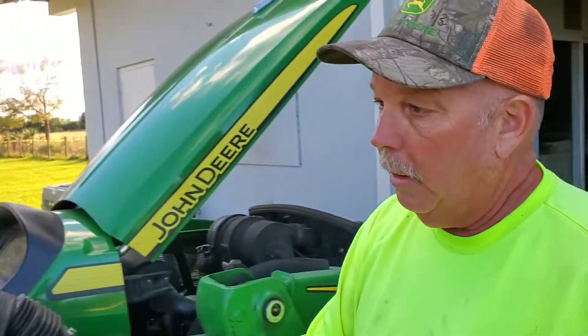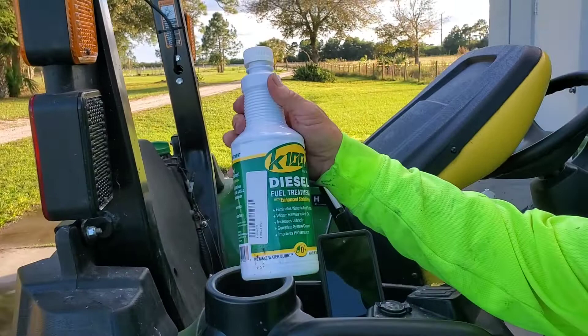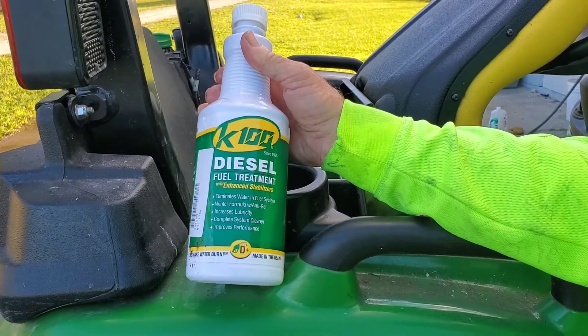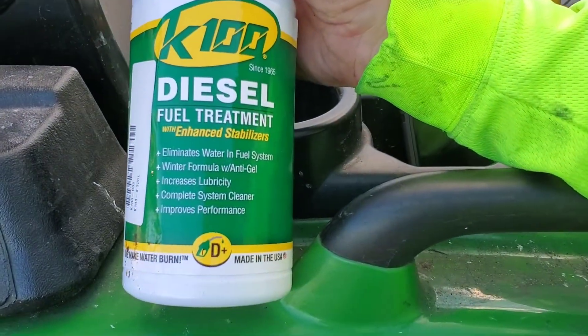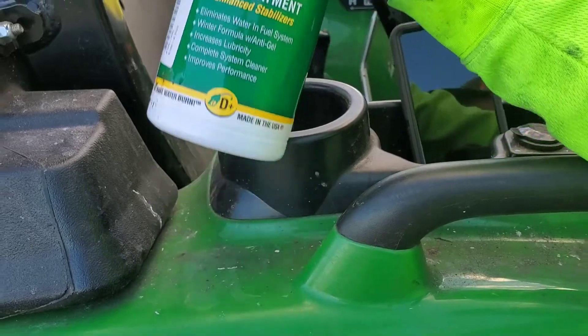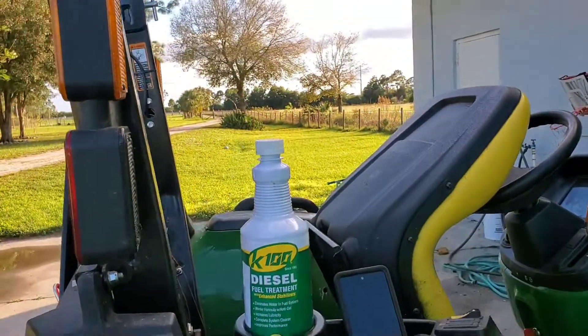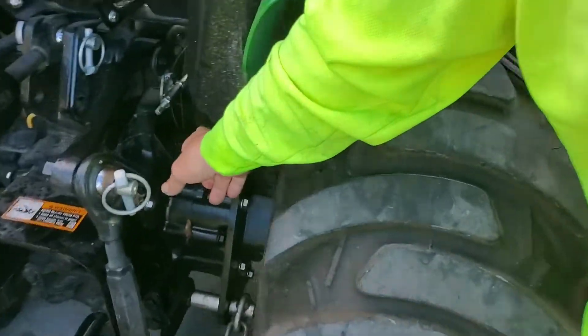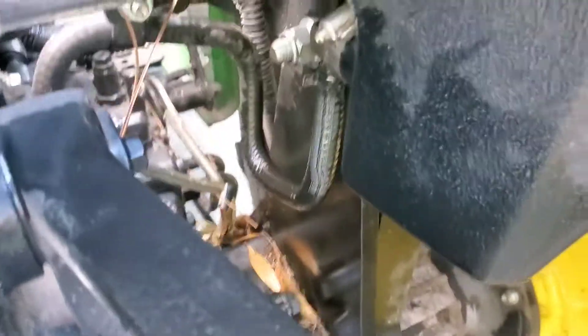But if it is the fuel pump, now you know how to change it out. And if it's not the fuel pump and it's a sediment problem, you need to be putting some of this in. He sold me a bottle of this for $27. Put this in there, let it set for 24 to 48 hours preferably, and then once that sets in your diesel tank you can pop that hose back off out here and drain your tank out.